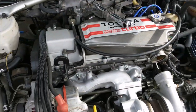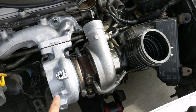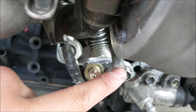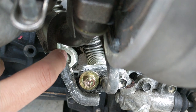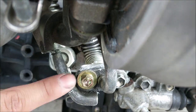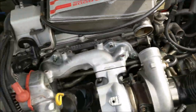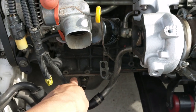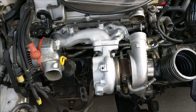In the meantime while the seats are drying, I'm reconnecting the CT26 7M GT turbo from the Supra. I did some painting and I had to modify this line right here to fit — I cut this support off just so I could get it to stretch down here, because that's the biggest limitation. I'm also connecting some of the new hoses up. Once I get the broken stud out of the oil pan, I can put new oil in, put the downpipe on, and we should be able to start it and see if it runs.